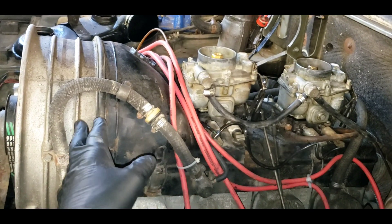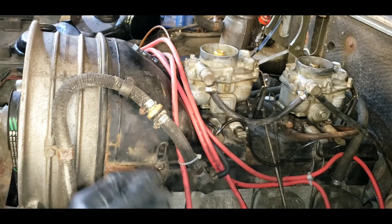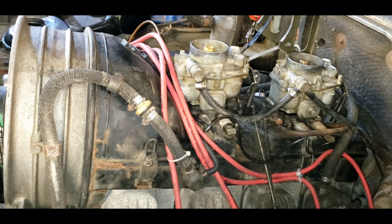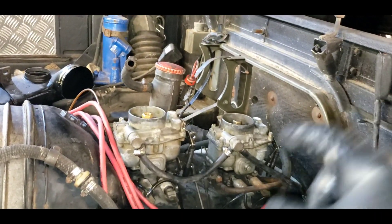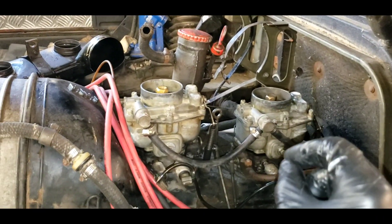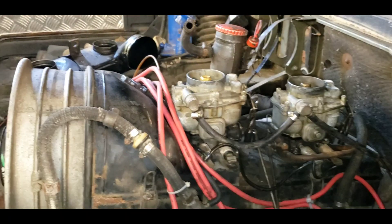The alternator, which is in the middle of the fan — the main wire had broken. This is a 24-volt vehicle. It was running out of power, so the customer was having to charge the battery. I found one of the accelerator pumps was not squirting the way it should, and the engine was just running rough, fouling spark plugs.